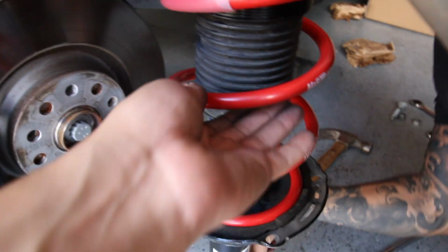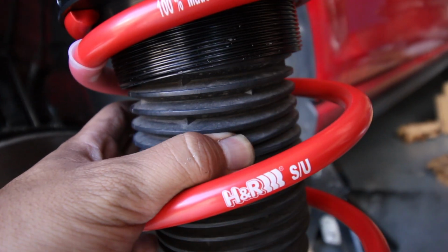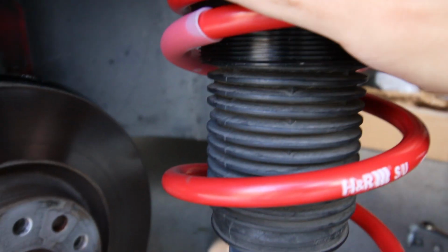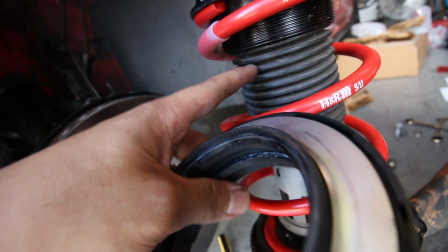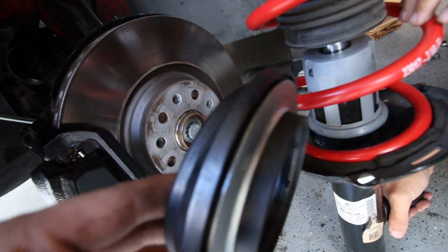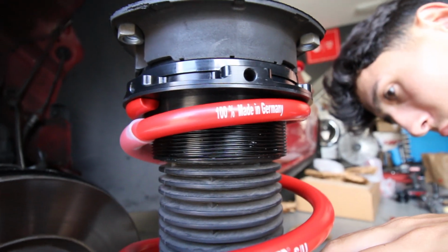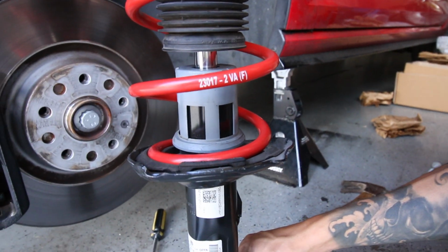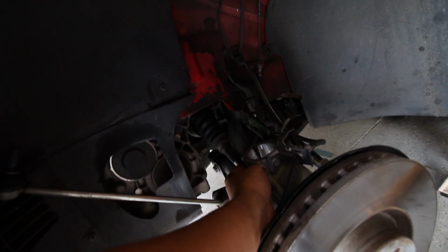We just put the H&R adjustable springs on. We had a little issue trying to figure out the instructions. It says the OE sleeve. Basically the OEM sleeve comes with this. So when you take the spring off, this little sleeve right here has this on top. You just pull this off, and then essentially you put the sleeve inside the adjustable coilover piece that H&R has. So this is what ours looks like for reference. And as far as taking things out, it's just the 3 on the top, 14 millimeter triple square with the 18. That's about it.